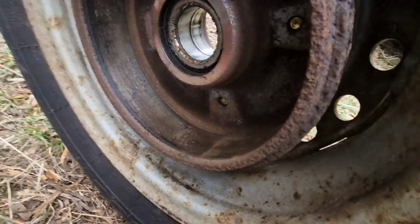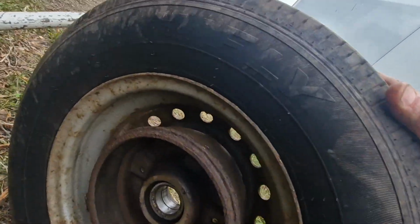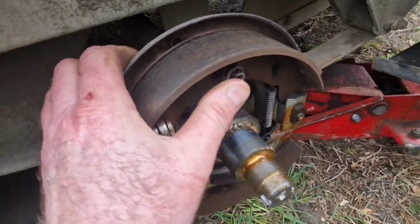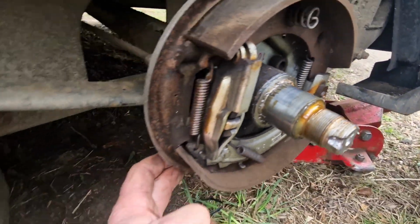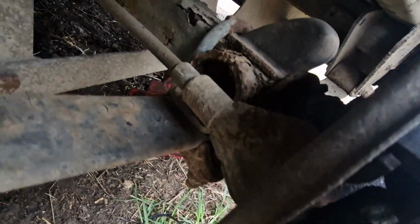As you can see, the drum is actually in good condition. There's no lip. The bearing's in good condition. The inside of the tyre is in good condition. The rest of the tyre is good. And the shoe retaining clips are all in place. Everything's in good condition. Linings are good. They're not worn or cracked. So yeah, cable's all in there, the shell on the back's not damaged.